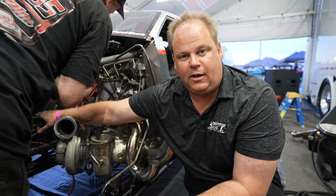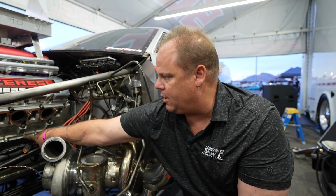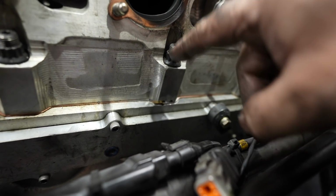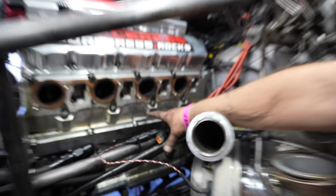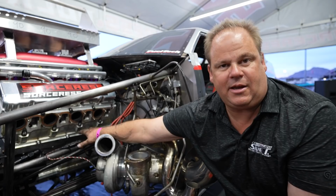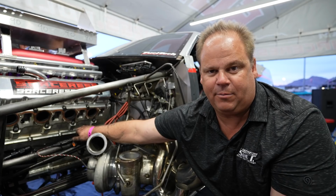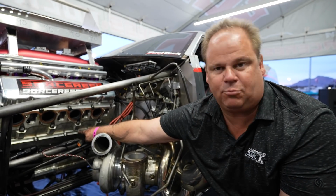We've been having this problem where it's trying to backfire, and it's on this side of the engine, right? And we just brought it back after the last backfire, and all the valve train's still on it. But we can hear a whoosh noise when you're cranking the engine over. So there's compression leaking from somewhere. It stops when you take the number 5 plug out. What's going on is it's burned the deck of the head and the block around the number 5, in between the 5 and 7 cylinder around this head stud. So this compression leak is either just letting compression leak out because there's a problem with number 5, or it's potentially going to number 7, which is making it backfire up in the intake. Either way, we're going to swap the motor, but that's the root cause of our problem.